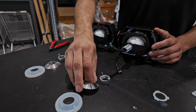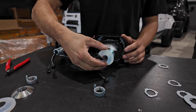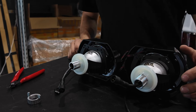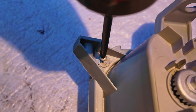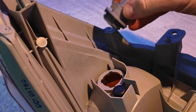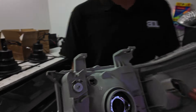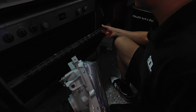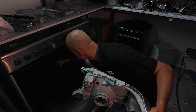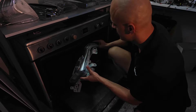Slide your round washers onto the projectors followed by the rubbers. Then we can move on to getting the light ready. Remove any screws or clips that hold the headlight together around the outside, and preheat your oven to about 100 to 120 degrees, non-fan forced. This is going to soften up the glue. Use a bit of wood to prop the headlight up so no plastic parts touch the oven directly, and place it in for four to six minutes.